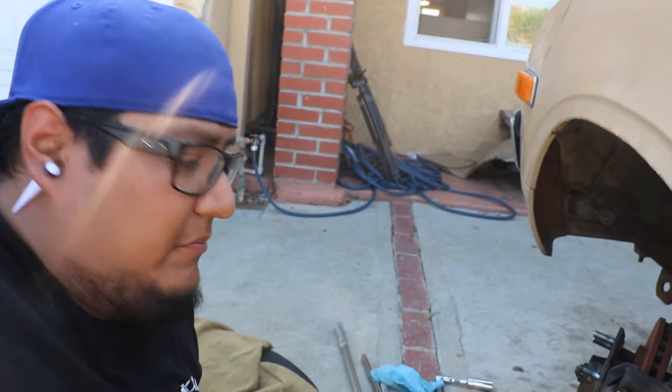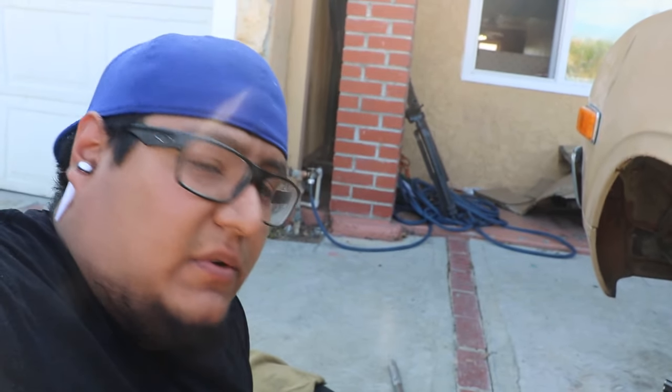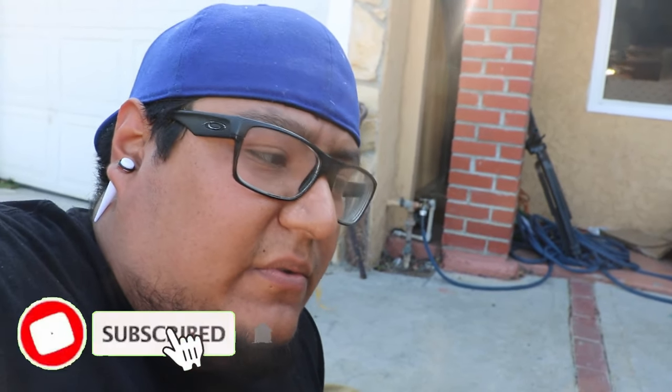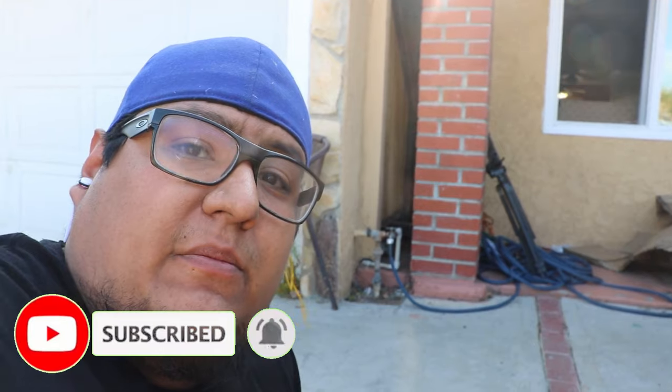So Pathfinders, any year, as long as it has two-piston calipers in the front, you can use the four-wheel drive or the two-wheel drive, they'll still fit. I usually just go for the two-wheel drive to make my life easier. There's more two-wheel drives than four-wheel drives out there anyways, so you'll find a two-wheel drive easy. I would recommend getting a two-wheel drive Pathfinder or hard body V6, and get the brake caliper, bracket, rotor, and the hub off of one car and use that. That's it. So pick one and get it. Whatever's available, whatever you can find, whatever you can steal. I'm not condoning stealing, but however you get it is your problem, not mine.